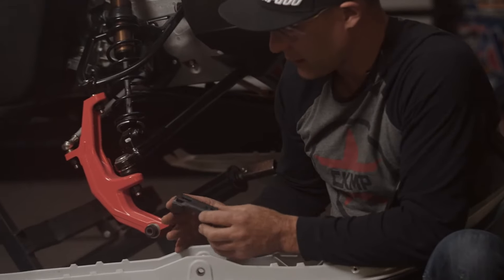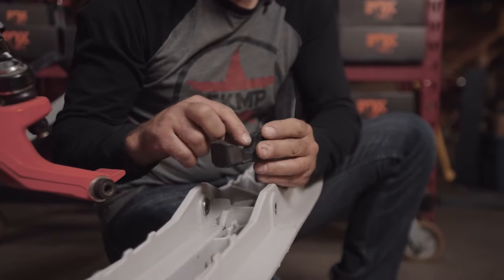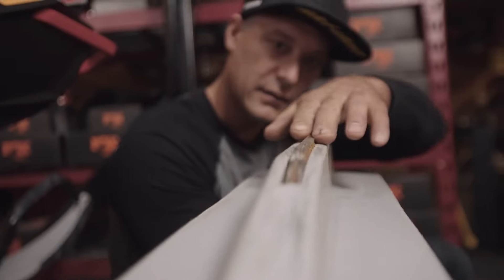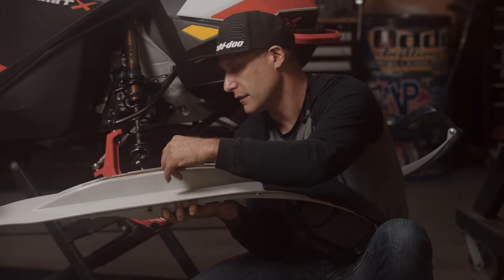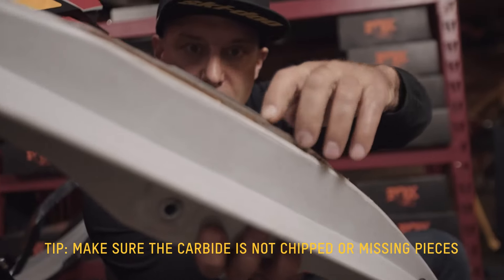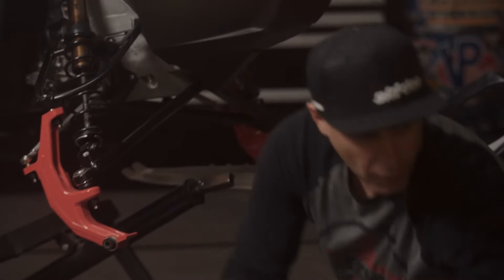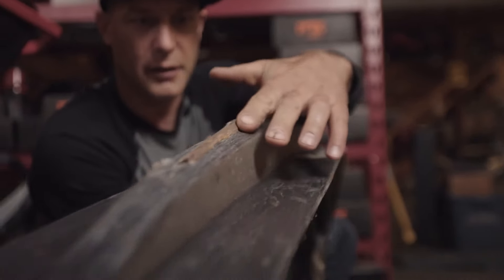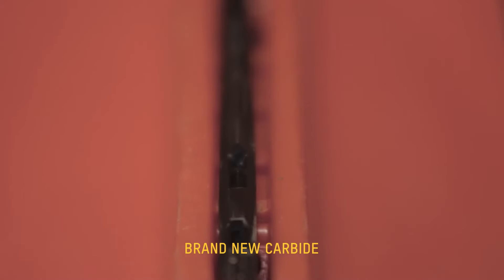You can see this rubber is in pretty nice shape. There's no cracking, there's no distortion. It's still as it would be from new. You can see the carbide is nice and straight, or the skeg is nice and straight. If they're bent, change them. You can look in here and see there's actually no chips — the carbide is one continuous piece. I'll show you one that probably should be changed. That thing kind of looks like a hockey stick — carbides are all busted apart. If you're going to ride early or late, you're probably going to change one or two of those in your career.